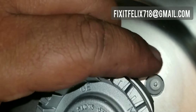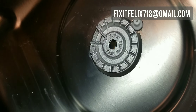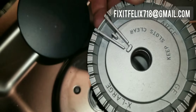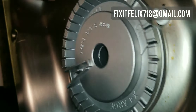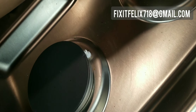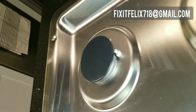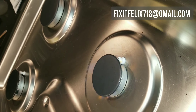Right there it won't go, but when I twist it, it falls into that little notch. Do it with all of them — just make sure it fits and sits flat. Make sure everything is nice and flat. The only thing left to do is plug it back in. Now we have to test it out. As soon as you put it on light, they should all click at the same time. You want to test everything out once you install everything back together — make sure they all turn on. This one here was the problem burner, and it's all back to normal.